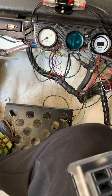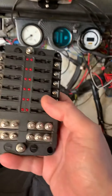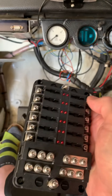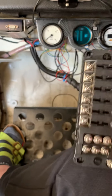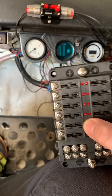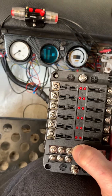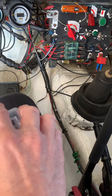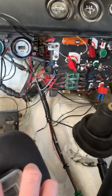So I've got this little item — another Chinese thing — but in the interest of testing I'm going to fit it and try it. You've got an earth connection at the bottom on an earth bus bar, and then live at the top with blade fuses, with a little LED that comes on to tell you when the fuse is blown. That's going to be quite trick and help with solving problems on events — again, you don't want fuses to blow, but when you see insulation overheating you know something isn't right.